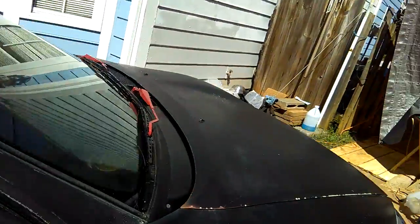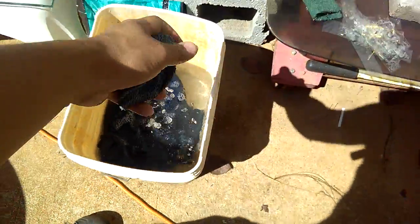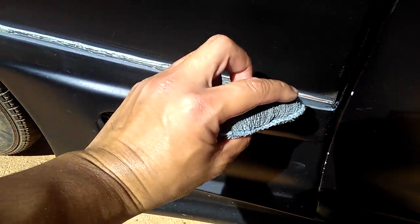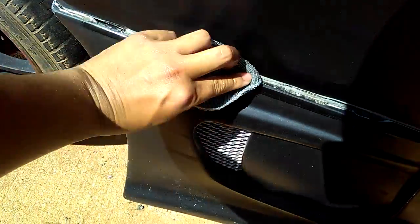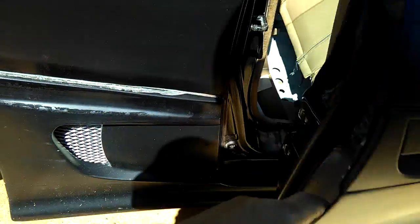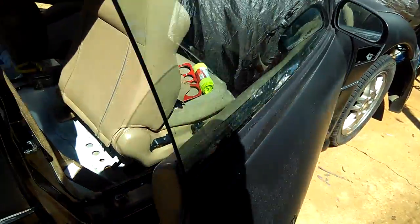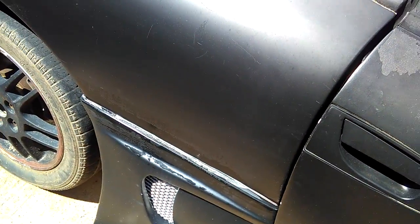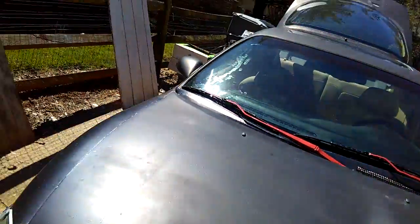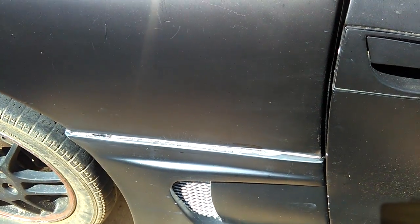Next, simply use a water pad or towel with water to wipe it down. After blowing all the dirt, use anything damp to wipe it down well — don't use too much water, just enough to clean out all the dirt around it. Let it dry; if you need to dry it quickly, use a heat gun. I'll leave it in the sun for about five to ten minutes to dry before I put the body filler on.